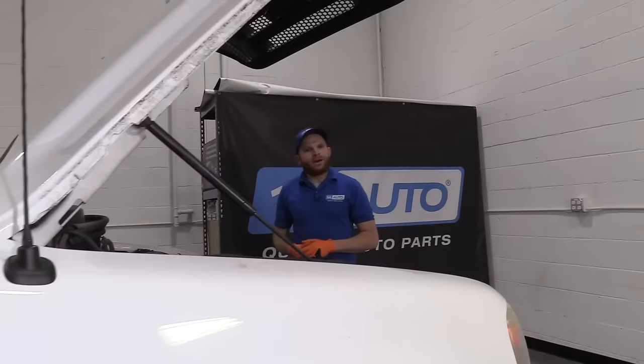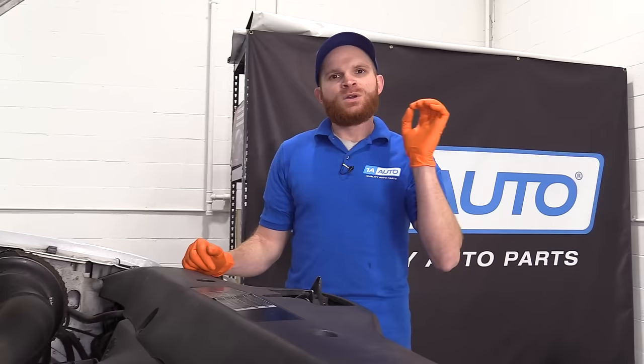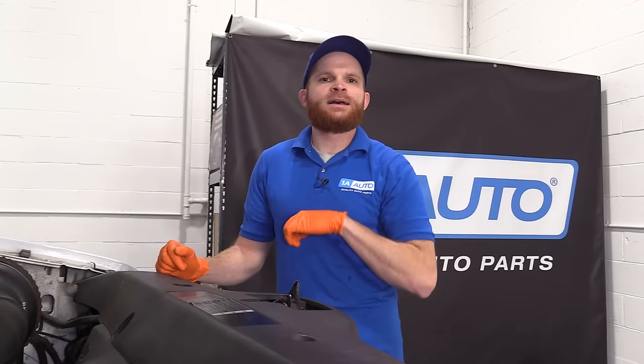The next thing to talk about on these vehicles involves coil packs. The symptom is basically a check engine light on your dash, and if you pull the code, it's going to come up with something along the lines of P0301 through P0308. Each number at the end — one through eight — designates which cylinder has the issue. These coil packs are known to go faulty internally; it's just bound to happen, and when it does it's going to trip a check engine light and tell you which cylinder is showing the problem.